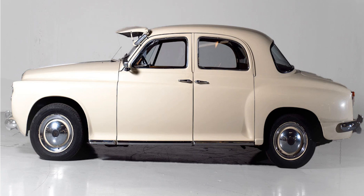Bodywork. If the seller will let you remove the rear wheels, it's the best way to check the chassis as it rises at the rear. This is a water trap, owing to the design where Rover attached the bump stops. Rover used good metal so it can be repaired, but it'll cost money so it needs factoring into the purchase price.